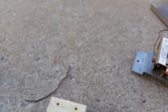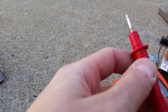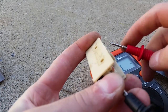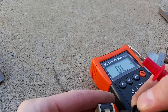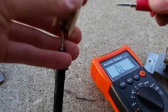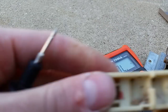While this is on the heater, you can also test it like I did in my last video. You take your multimeter, set it to continuity, and then when you short out the probes you'll hear a little beeping. So we'll do that right now and I'll prove to you that this one is no good. I'm going to touch here - you can see I've sanded the little contacts to make sure there's not just a bit of dirt keeping it. So you can see when I touch it, it does in fact go. I'm going to depress the switch, and you can see there's nothing happening. So this is FUBAR.